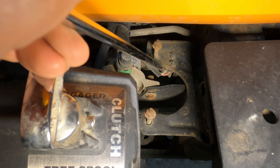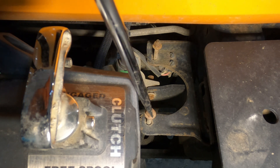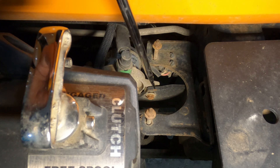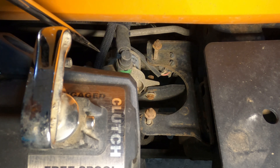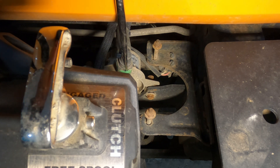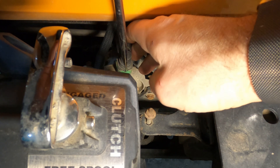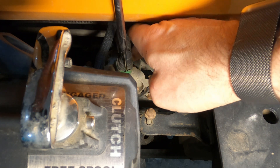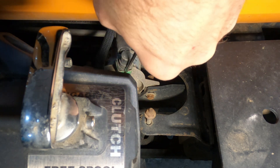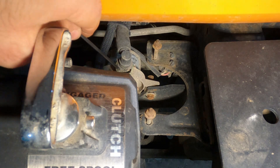Down here is where you have the stock electrical connection. These two bolts are 10mm if you're still using the stock location. My bumper also uses 10mm fasteners, so it won't be too bad. And this is the connection here for the vacuum — you pop it out, and depending on the location, it may be easier with a small flathead screwdriver.